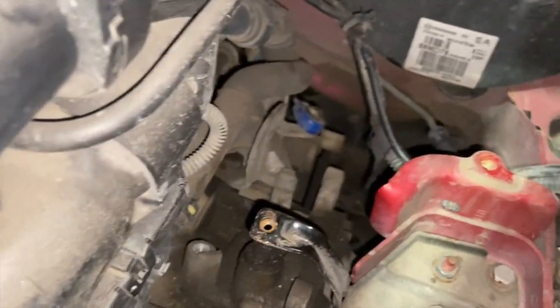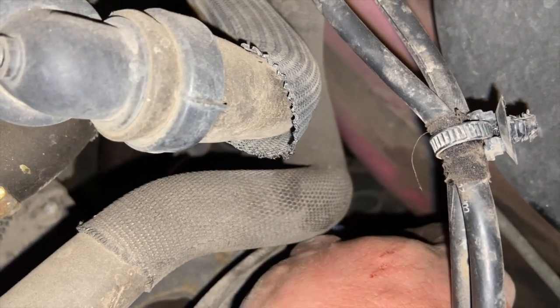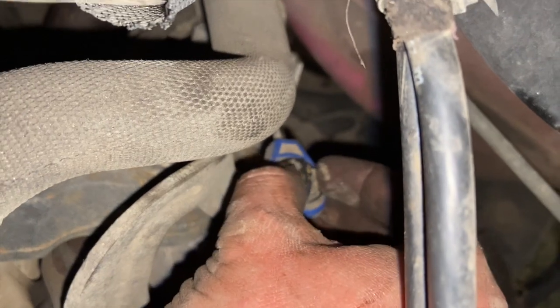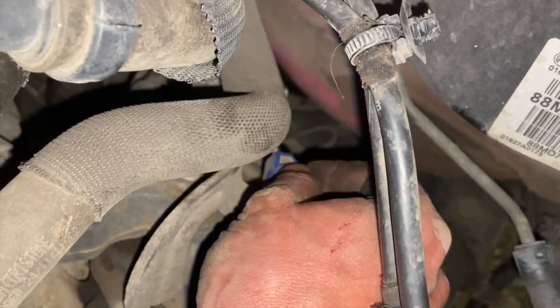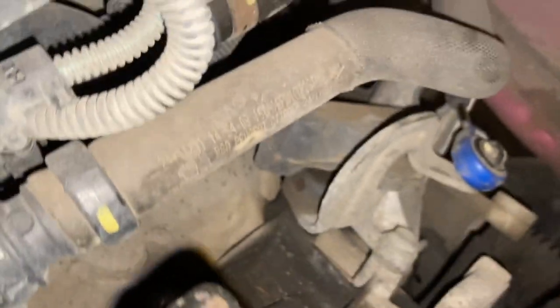Yeah, so with the back bits out, just going to pop the ends off now. And it's probably a bit hard to show you on the camera, but basically what you need to do is pinch the two white bits together and then push the middle in and you'll be able to get it off. I can't quite do that well holding the camera, but basically you see these two little outer tabs, they just push inwards, and then when they're in you can push that middle bit down and that'll release it around the ball. It gets a little bit tight again, so you sort of work it with two hands while you're doing it. Obviously we've popped both off now. Once we've got them off, we'll be able to access that starter motor bolt.